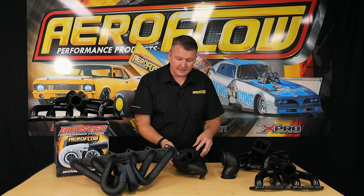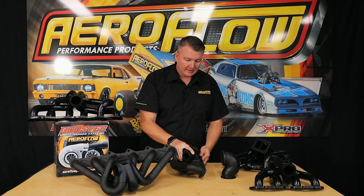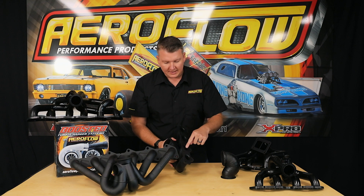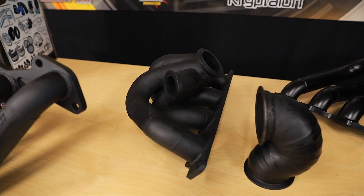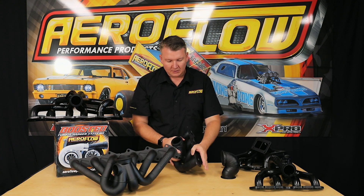This is all three-millimetre steam pipe, mandrel bent in the bends and then welded together. Then we have the flange, which is a 10mm flange. On most of the applications the Evo is a little bit smaller because we've got a clearance issue, so we've gone to a slightly smaller flange on this one. That is all welded together and then once the manifold is completely welded, we've machined the flange down — milled the flange — so you've got a nice flat surface for mating, so that your gasket stays sealed and stays in place for longer.